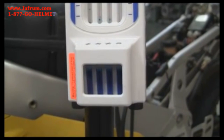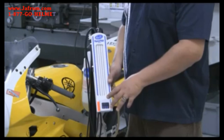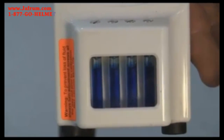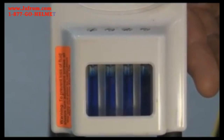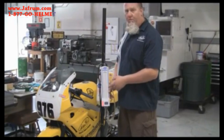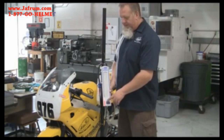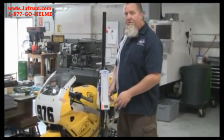You don't need to block off the other channels — they're completely independent. The reservoirs at the bottom of the tool hold the SyncPro fluid, and the fill level is a really critical part of this tool. There is a small airspace between the top of the fluid and the bottom of the calibration screw, and that airspace is what actually allows the fluid to move up and down in response to vacuum. The higher the vacuum, the larger that airspace will expand and the farther the fluid will rise in the columns. If the airspace is too large, the vacuum limit of the tool is reduced, so that airspace should only be about a quarter of an inch.